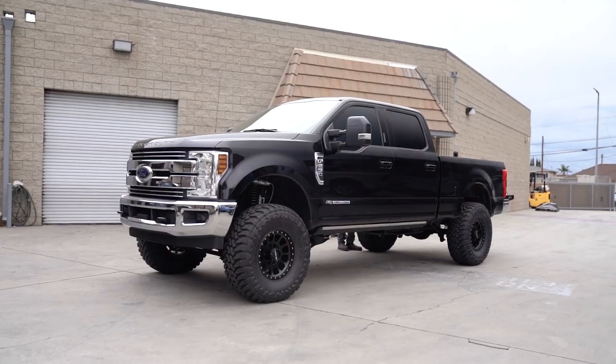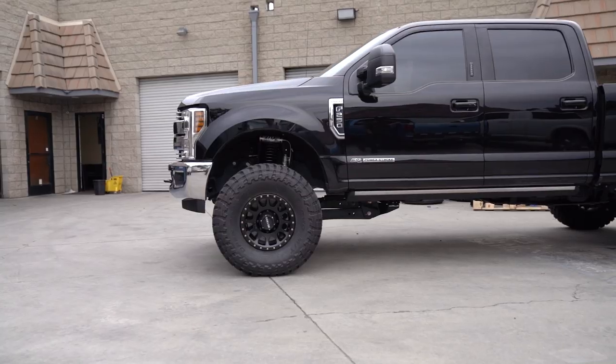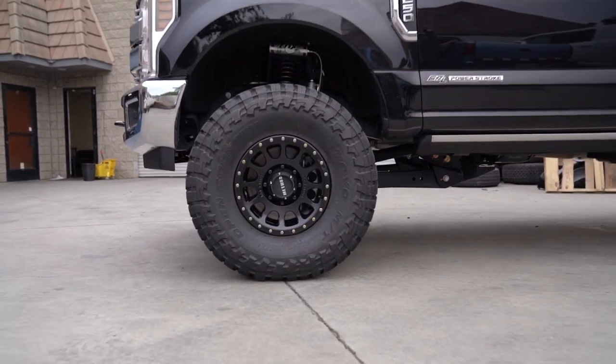We just wrapped up the installation of the Carli 4.5-inch Backcountry on this truck. The customer's goals were to have a soft-riding setup that he could still use functionally for towing — I'd say we've definitely achieved that goal. This truck rides considerably softer than stock, and the towing capacity is retained thanks to the Carli add-a-packs. There's a reason why the Carli Backcountry is one of the most popular systems that we sell. It's great for guys looking for a smooth-riding, better-handling daily driver without spending the kind of money it takes to get into King shocks. I'd say this system will suffice for 99% of people trying to do desert running with these trucks. Thanks for watching — any questions, feel free to reach out, and many more of these videos to come.